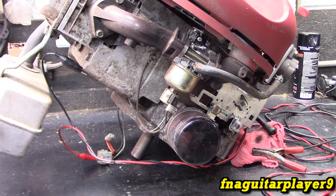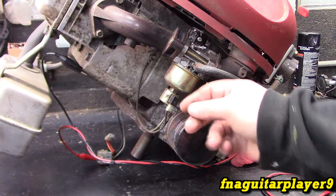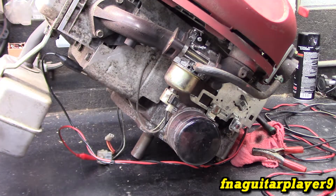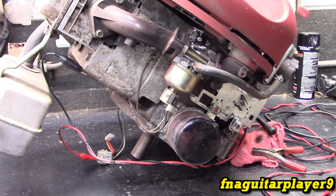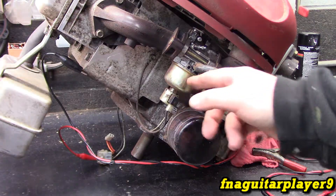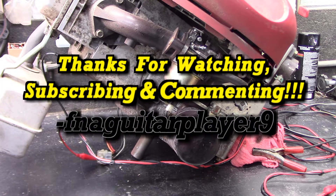That's pretty much all we're going to cover in this video — I'm trying to keep it short. I do have a video on how to change this, but it's very simple. If you have to, you can take a regular wrench and grind it down to fit in between there — I'm pretty sure it's half inch. Or you can get what's called a service wrench, which is thin almost like a piece of sheet metal. It's a pretty common problem, especially if you have gas sitting in there for a long time — everything can gum up and stop that plunger, and you can probably just free it up. Questions or comments, leave them below. Thanks for watching!